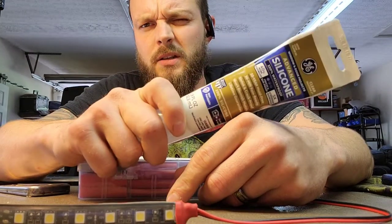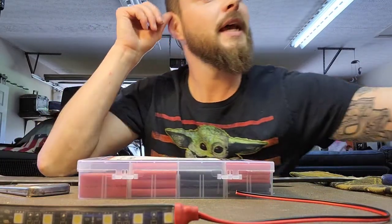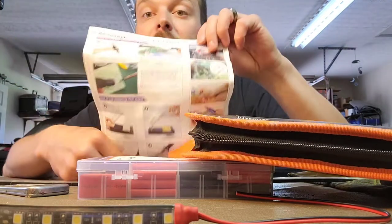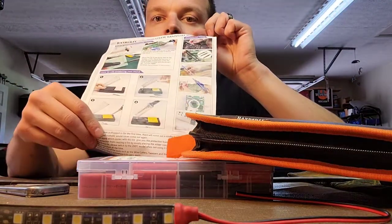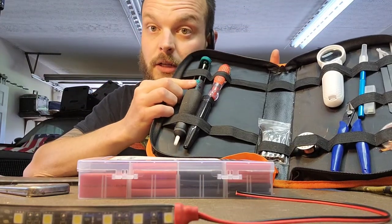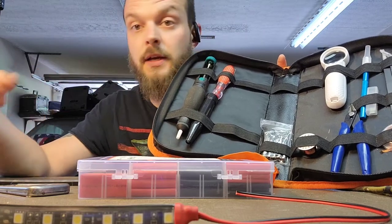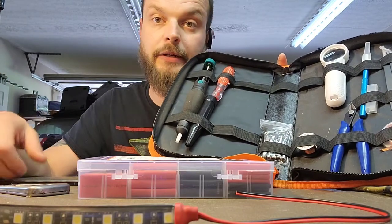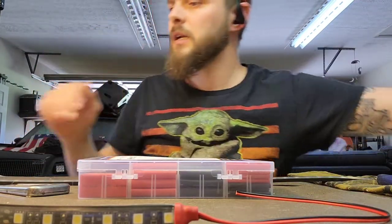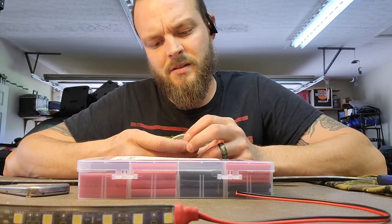You will need some silicone — I'll put a link in the description. And if you don't have this, you will need it: it's a soldering gun. I found this kit that has everything you need; it's not too badly priced. It comes with a stand, a soldering iron, a bunch of tips, and also a plunger which will be useful for wiring. The plunger works by melting the solder, setting the plunger, pressing the button while the solder is melted, and it just sucks it right up.